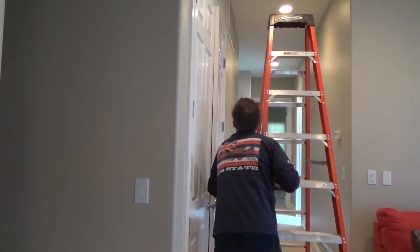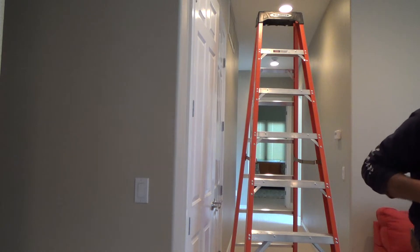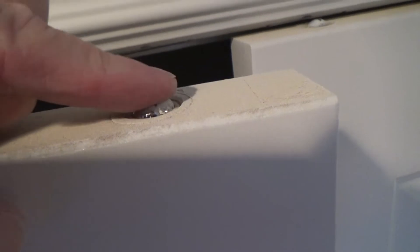Let's get these doors open just a little bit. See this one — just as I thought, it's down low, much lower. That means the ball is low. See there's plenty of clearance between the top of the ball and the bottom of the trim casing. That tells me I should be able to raise it up and get it in there more.